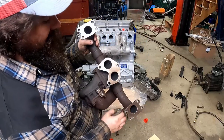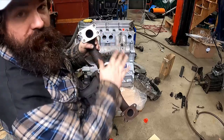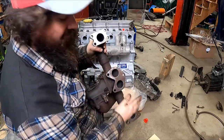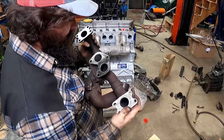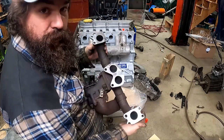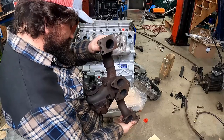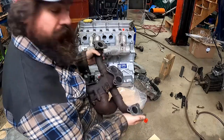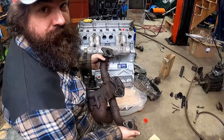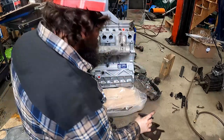Just so you know, I did take that Scotch-Brite material and really went over all these surfaces nicely. I checked them with a straight edge and they look pretty true — the gasket should be able to handle that. I know you're supposed to decoke these once in a while; I'm looking in this one and it's just not carboned up. So that's how we're going to leave it.